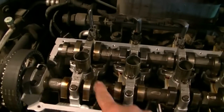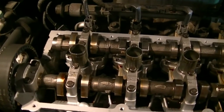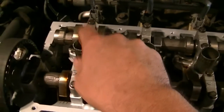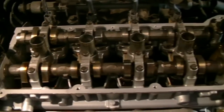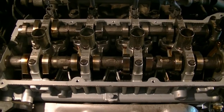And also, if you can, get a straw or an oil sprayer or oil can and get some oil into the spark plug wells. Not in the spark plug wells, but onto the cylinder. Try to get it all the way onto the cylinders, because the cylinder's been sitting a while and we cleaned them, so it's gonna help with the dry start.